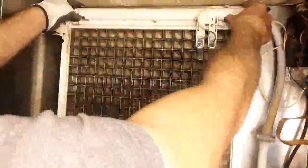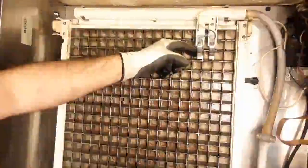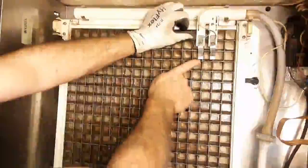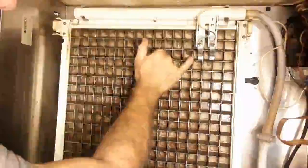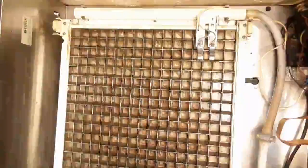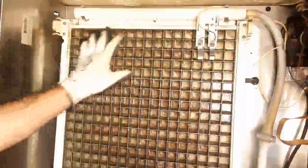You're never going to get it 100 percent perfect, but that's still okay — it'll still freeze up. Also important: you don't want the sensor touching the tray. I usually keep it at about three to five millimeters. The ice is going to build up and create a thin layer, and those two contactors will make contact — triggering the PC board to start the defrost cycle.